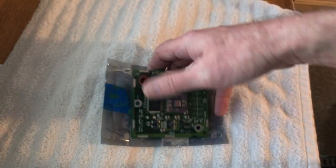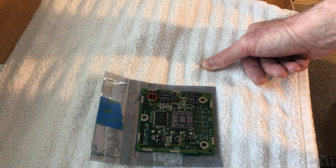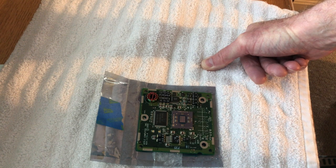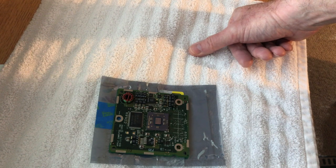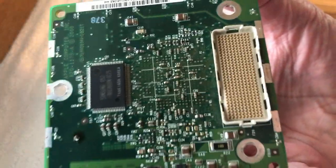I also ran Geekbench on it, in Tiger and also in Leopard. In Tiger, it took about 11 to 12 minutes, which is pitifully slow by today's standards, but it does it. I got the Geekbench scores, and we'll go over that after we do the upgrade. Leopard took about 21 to 22 minutes with a much lower Geekbench score than in Tiger, largely due to the bottleneck of the clock speed. So we're going to swap this board out, and then do some new benchmarks. I'll give you a closer look before we cut to the different video.